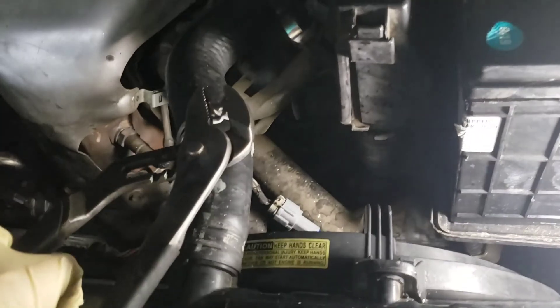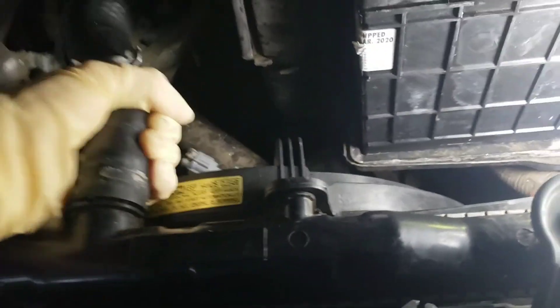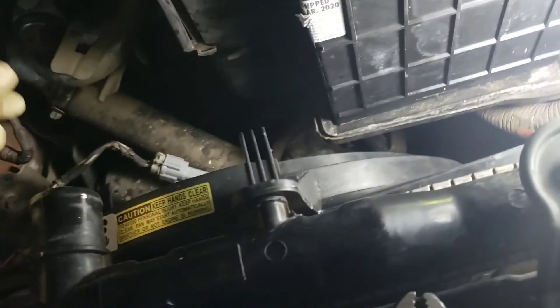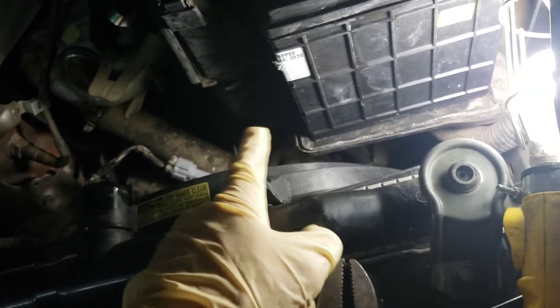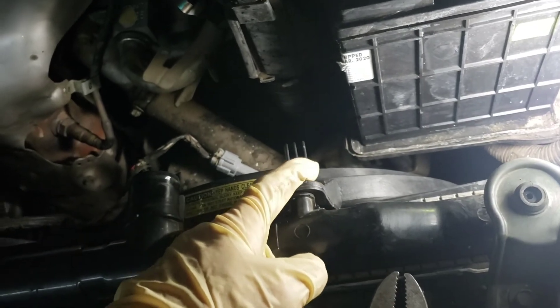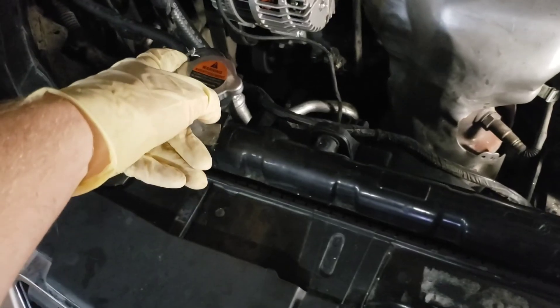After a little bit drains out, you can go ahead and remove this clamp for the upper radiator hose. Just spin it like that — if you're having trouble pulling it off, work it off. There we go. Now we can fold it out of the way. There are two 10-millimeter bolts here that hold the fan assembly in, so we're going to remove those. There are also two 10-millimeter bolts that hold the radiator to the radiator support — we need to remove those and remove this hose here.